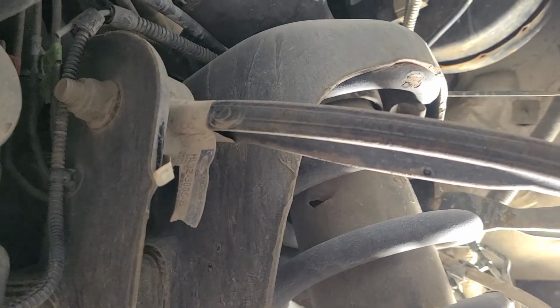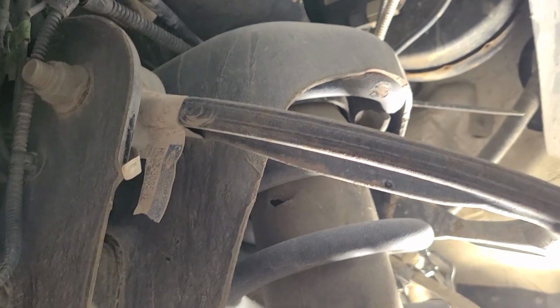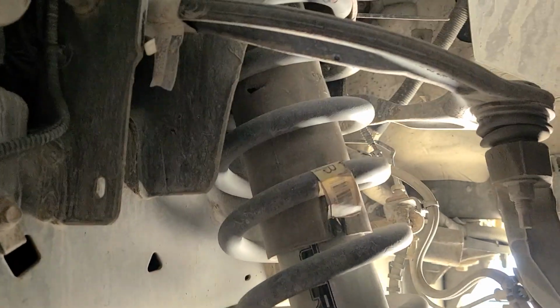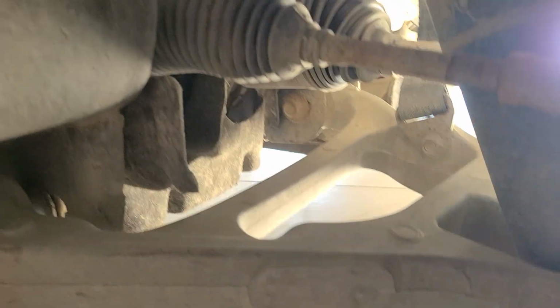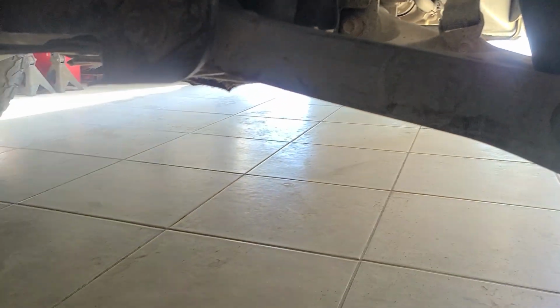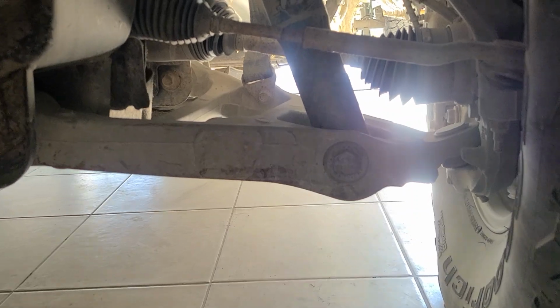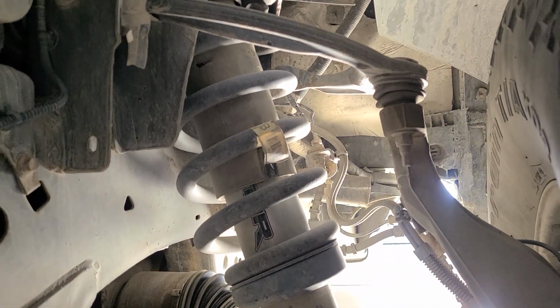I have not modified the upper coilover towers. You can see here they're not modified in any way whatsoever. It's a Gen 2 shock in there, Gen 2 upper control arms, Gen 2 everything, Gen 2 lower control arms, all just bolted on. It's nothing special about it at all. And as you can see, the lower control arms are not on any sort of stupid angle, pretty much stock Raptor geometry. The upper control arm, once again, is not on any stupid angles.